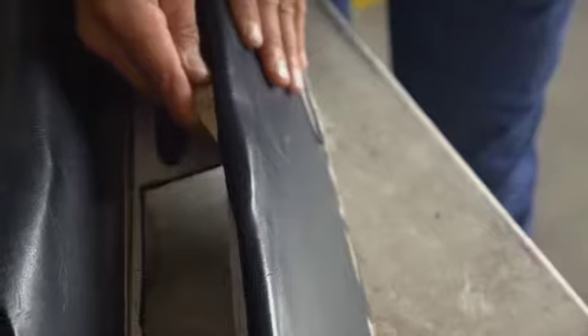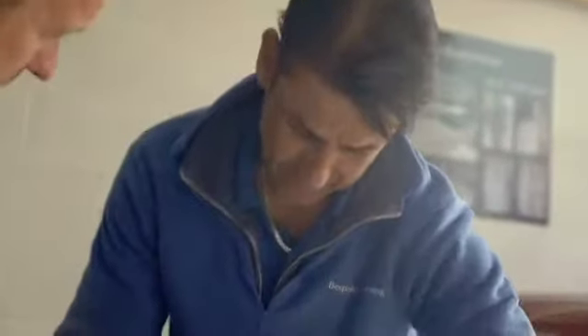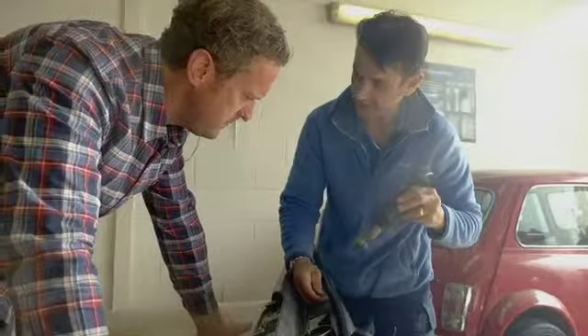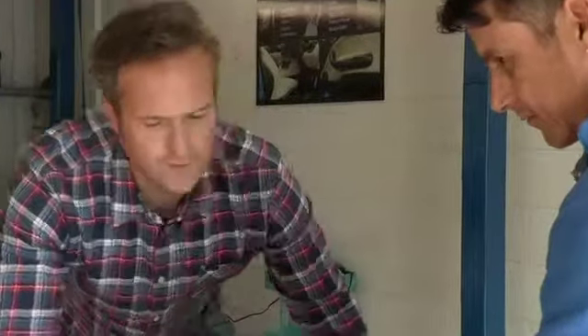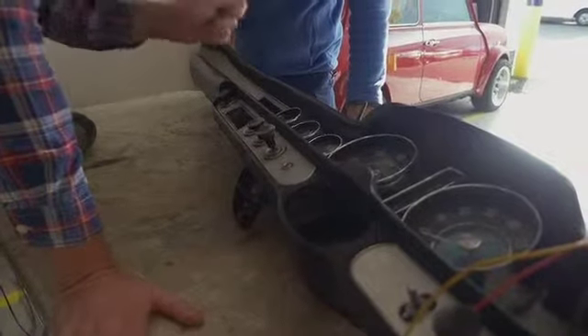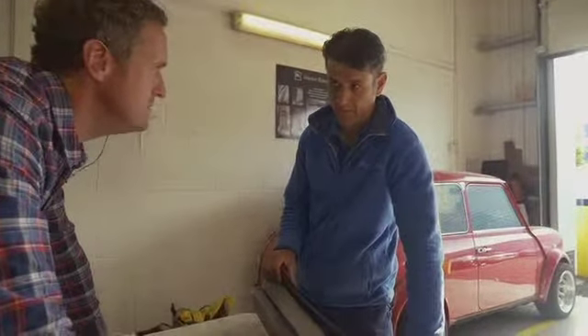So that's kind of pushing it back - heat it up, slowly massage it. So you're reforming the piece of vinyl on the top. What's going to fill the gap underneath? If it's got any movement, we could infill it with a bit of neoprene. I've always replaced dashboards when they've got that same sort of vinyl foam sagging thing going on - never thought about cutting it open and trying to reform the plastic. It's a pretty gutsy way to go though; if you go too far, you've damaged it.